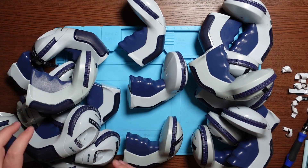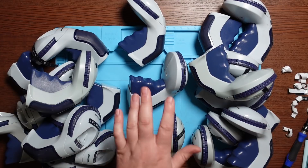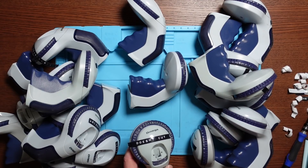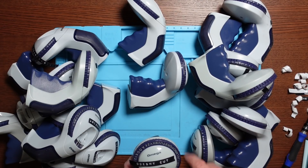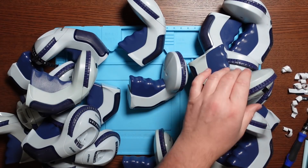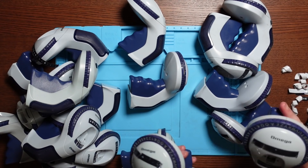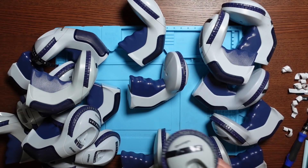Right, so I've got three piles. Got this enormous pile on the left which is the ones that are working fine - there's absolutely nothing wrong with them. I've got these three in the middle - actually there are two different things here. These two don't take the tape at all, so there's just nothing - I can't test it any further. This one does print, as you can see, but it doesn't cut. So when you get to the end you have to pull it out and cut it with scissors. Other than that, that one is working. And all of these aren't working - they take the tape but they don't print anything legible. You can see a bit of an A there - nothing on that one, nothing on that one. Most of them just make a couple of little lines - they're just not embossing it properly.